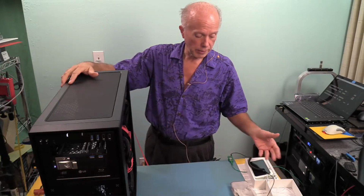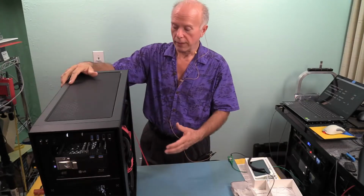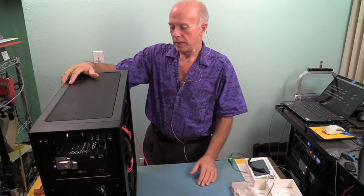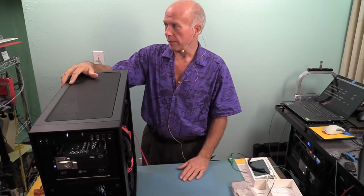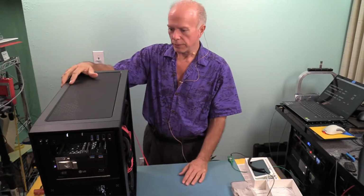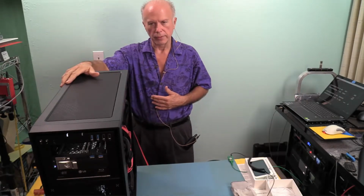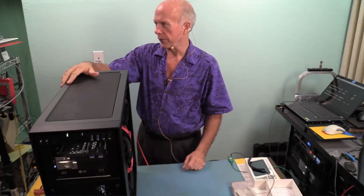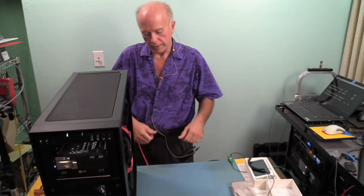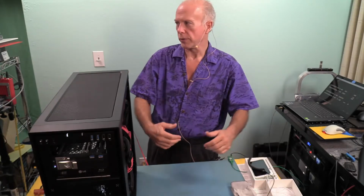We got to look at that while Belarc is doing its thing. We got to look at the RAM in relation to the CPU fans with the endoscope, which was kind of cool, I think. So we've got all of our RAM in, got the video card back in, and with this motherboard the latch was already down. We didn't have to flip it down, but it was easier to get to with the fans off. And I did pull the fan off on the closest to me on this side by just pulling the clips off the fan. But when I put the fan back on, I had the video card out, and the video card being out made it easier to get the rest of the RAM in. So we got all 8 sticks of RAM in.